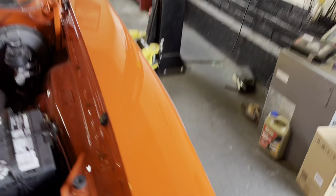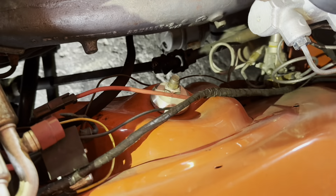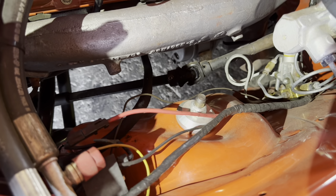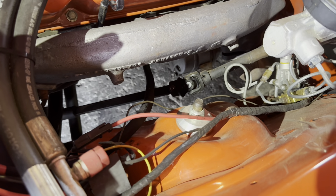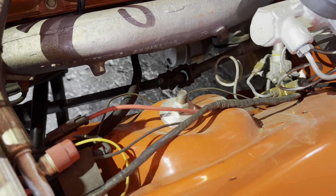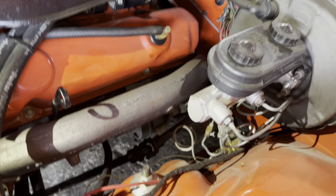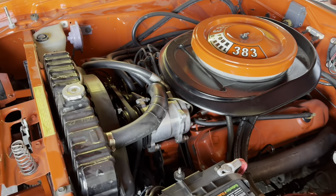So here's what I was talking about underneath - you've got coilovers on this and there's no reinforcement on that inner fender. It's just not designed to handle the load of the car. The really good k-members - I think this one's Magnum Force - have reinforcement for that on a stub underneath. On this car it's like that's just not a good design. I don't know if there are any engineers watching this, but that's not a good design. It's not a deal breaker - we knew that going in - but it just kind of bothers me.